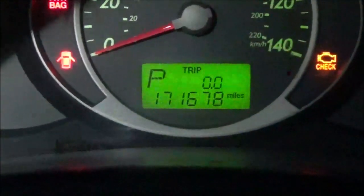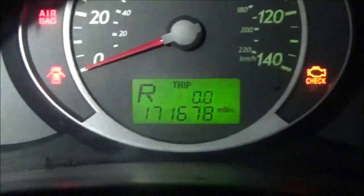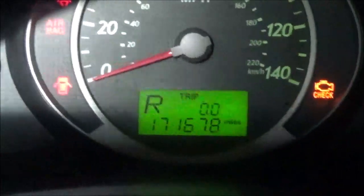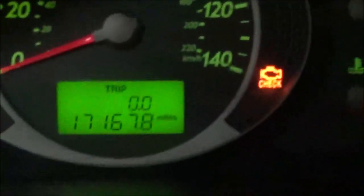Okay, it's in Park. Now — reverse. See that? Now I'm in Drive and it's still showing reverse. I'm in neutral — see that's neutral down there, but the indicator shows reverse because that tail light is putting voltage on the reverse circuit. Let me go down to Drive. It's in Drive and it should show Drive, but it shows nothing.